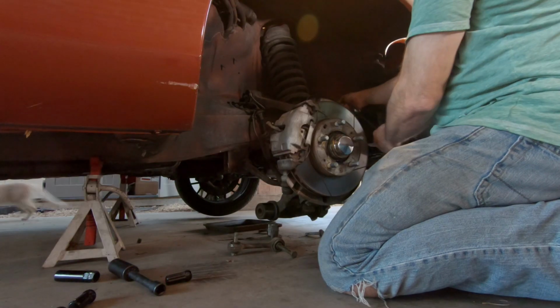And the same thing goes for the upper control arm. Go ahead and tighten it down, but not all the way down, and then after that same 4 miles, stick your hand back there and just tighten it down with a wrench. That way, this will eliminate any squeaky suspension that you may have and any kind of binding.